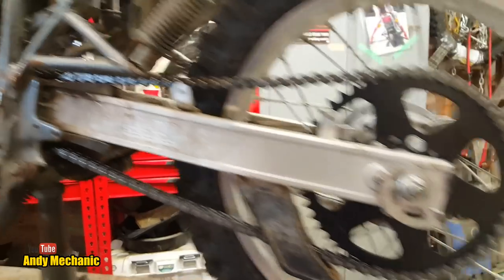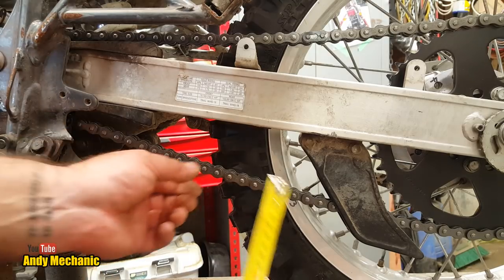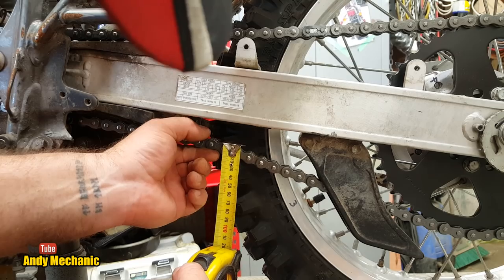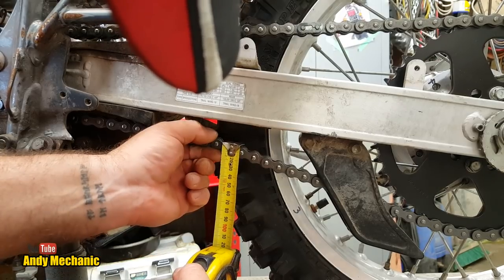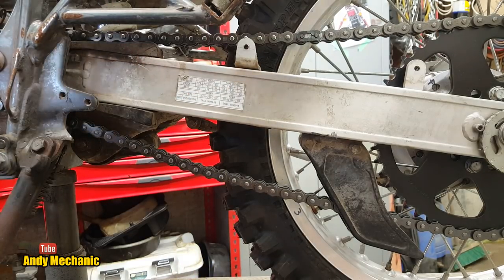Do I need to move you? Yes, I do really, don't I? There we go, look. But you know that I'm not editing the whole thing just for the fun of it. Okay, so 25 to 40 mil, looking at the top of the chain. Oh, look at that. 40 mil. Near as damn it, 40 mil. That'll do. Perfect. Quite happy with that.